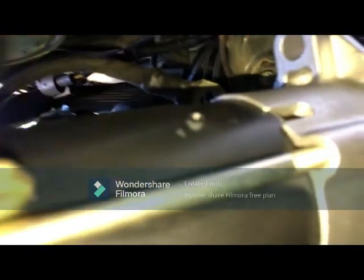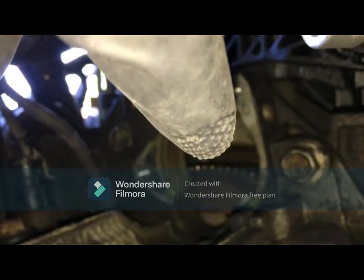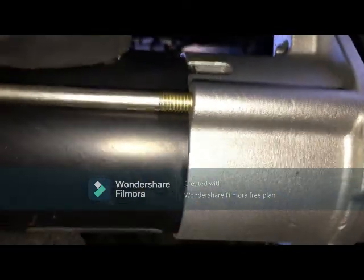Okay, so I'm gonna attach the starter now to the frame. Now there's a trick to this. You see this opening and you see this curve, right? You want to go like this inside, beveled at an angle like this, you see? So this doesn't engage to the crankshaft yet. So as you bring it down like this, it connects to the crankshaft gear, okay? That's a very easy way to do it instead of just fidgeting it inside.